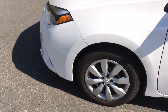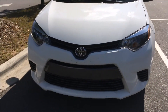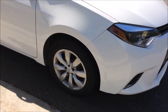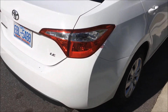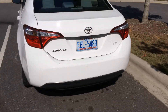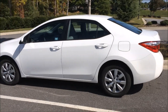Welcome back to another engine review. Today we're going to be looking at the Toyota Corolla — it's the SE package and it's a pretty nice looking car. It's a 2016. It's got variable valve timing, which seems pretty common for cars nowadays, where it has a mechanism in the camshaft to change the speed of the camshaft and the open and close of the intake valves as you speed up and slow down. It's supposed to help on gas mileage and emissions.